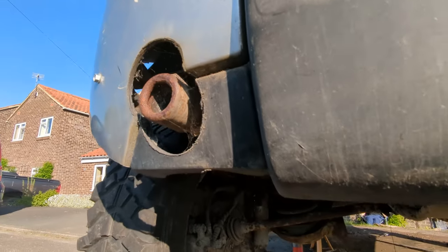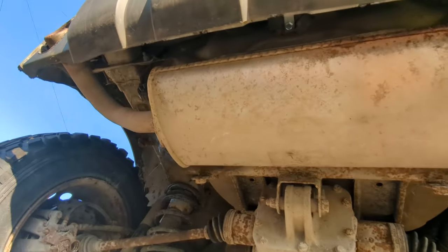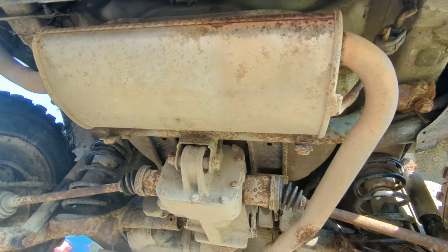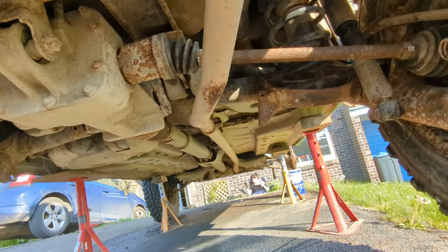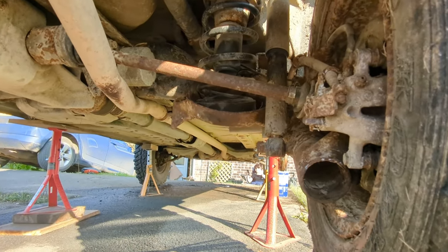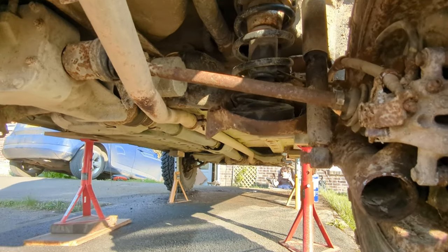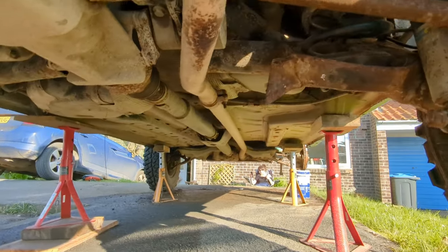The exhaust has been custom made from mild steel. As you can see from the state of it, I wish I'd had it done in stainless. It's been modified to suit off-roading with a smaller back box but it's still just as quiet as the standard system. It's also been bent in the middle to bring it closer to the body to allow for better ground clearance. Before, with the standard exhaust, the exhaust was the lowest thing on the car and the first thing to scrape, so I've had it moved up so that doesn't happen.